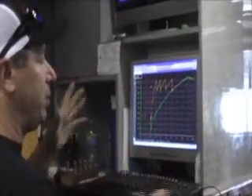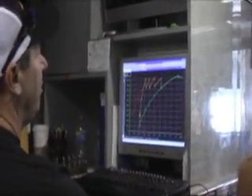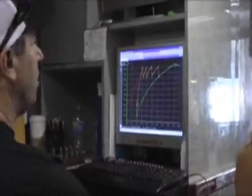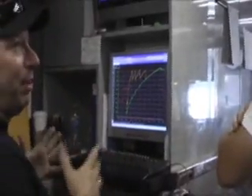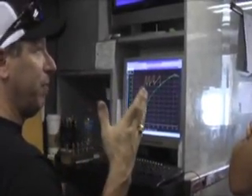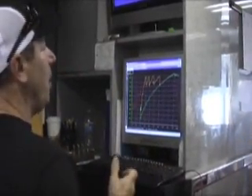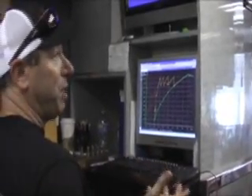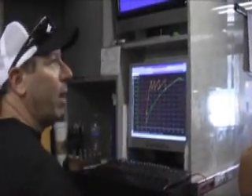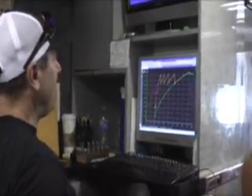I had the engine a little rich. Typically I like to shift at 10,400. But when I was trying to get up there, it felt real lazy at the top of the gear — started stumbling a little bit. In first and second you really can't feel it, but in third gear, if you've driven them enough, you've got enough time going through there to feel the motor just starting to hesitate when it gets up high. So I knew in third and didn't want to go high — I knew something was wrong. When I put it in fourth, I shifted out a little early because I didn't want to get back up there again. Sometimes you get it right, sometimes you don't — that time I got it right.